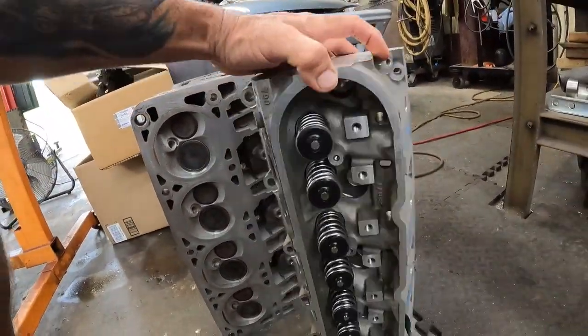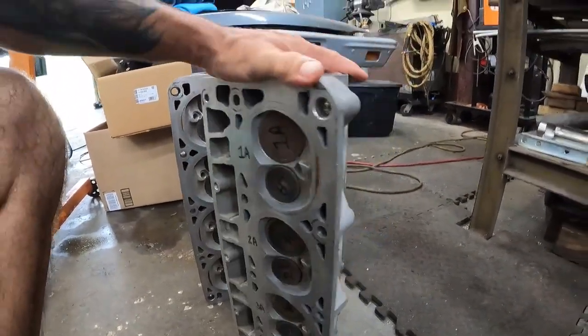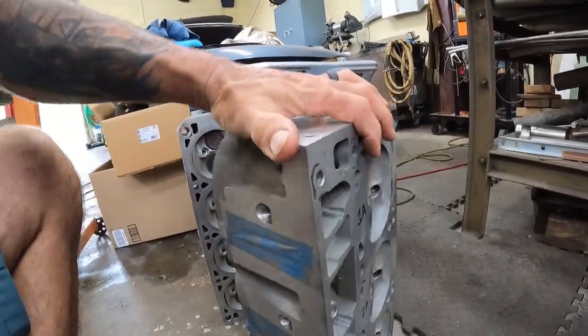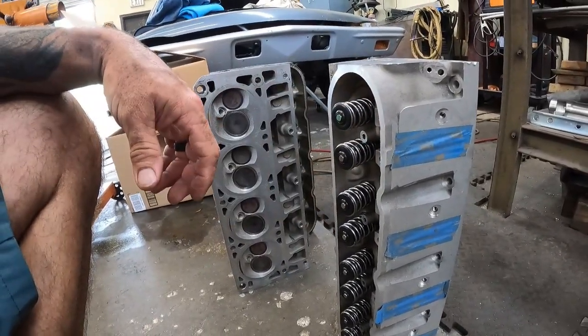Let's see if you guys can see this or not. I don't remember where I got these from, but somebody took a lot of time to clean them up and label all the valves where they go. So anyway, it's got those 660 dual spring setups on it with their retainers. We'll stick those heads on the 4.8 liter, and the main reason why is just because the springs are already installed on them. I don't really think there's a giant performance gap between the 706 and the 799, but there very well could be. So what I'm going to do is go ahead and set up the Trunnion upgrade. We can maybe see if I'm doing that right or wrong and take it from there.